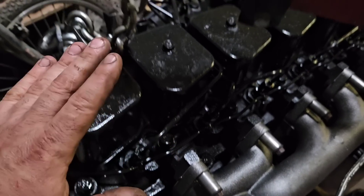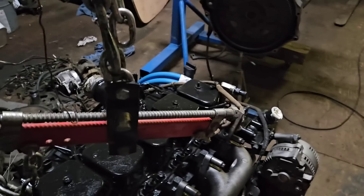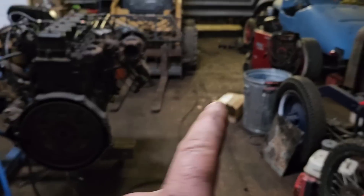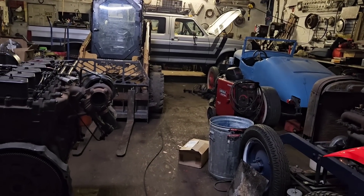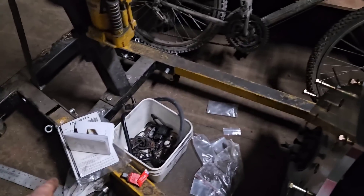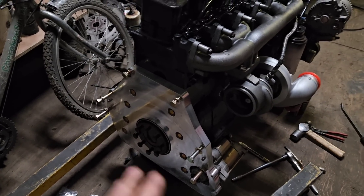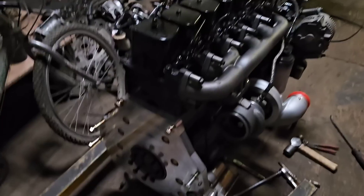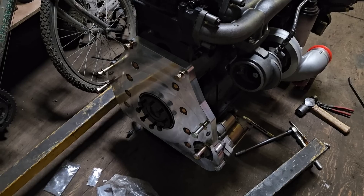You have to push the firewall up a little bit. Peg did it over at his place with a bottle jack and lumber — he just pushed it up. That was the smarter way. I did it with a bar and a sledgehammer on this one and it looks like crap. Lesson learned — on the next one I'm going to do it beforehand. That actually is in the instructions from Diesel Conversion Specialist. I'm not sponsored by them — it's just what it is. I bought the kit last time; it was really good on that silver truck. It just bolted right in, so I bought the same kit again.